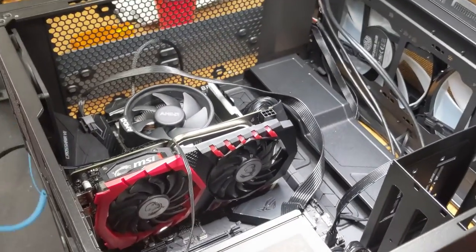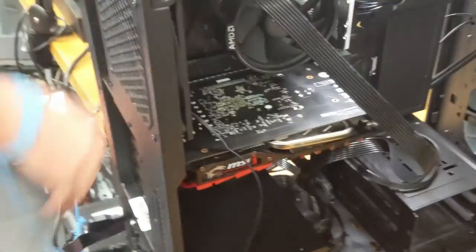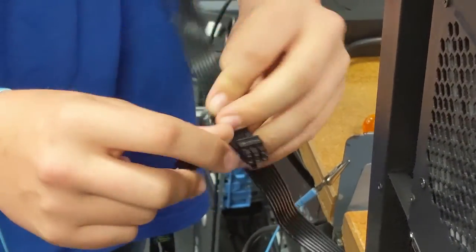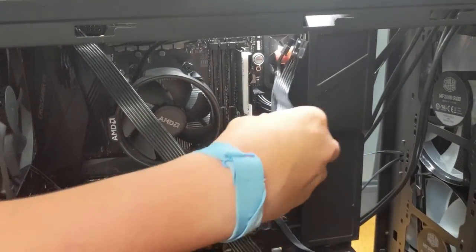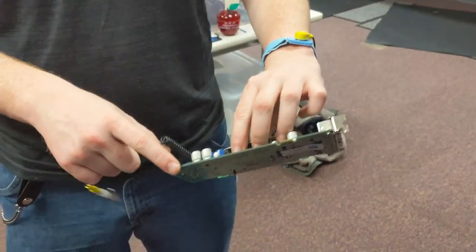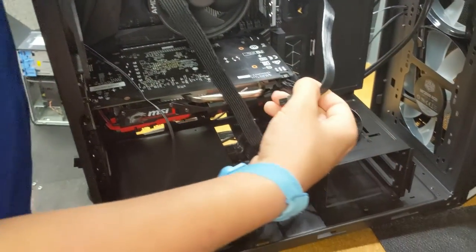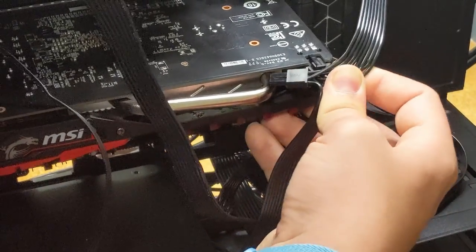Don't forget the power for the graphics card! This graphics card has a power slot since it is powerful — grab your PCIe power connector, usually a 6-pin, though there is an attachment for 8-pin because not all graphics cards are the same. Some legacy cards don't take enough power to need one. If you put in a network card, sound card, or screen capture card, you may not need it. Just a little bit of force is needed to push the connector in properly.